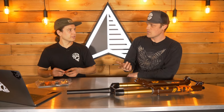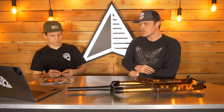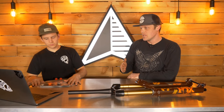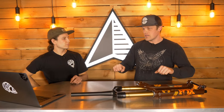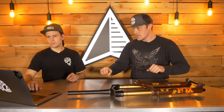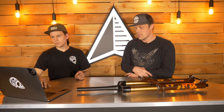Yeah. And a lot of people do call in and ask what's the difference. I guess if I had to put it in a way that's easy enough to understand without going into too many technical details, on the same bikes that I've ridden back to back, there's not one that's great and the other one's terrible. It's more that with the longer offset, the 51 mil on the 29er, I feel you have to put more steering input with your hands, and on the shorter offset you put a little bit more steering input with your body. So it just changes the way it handles, and one's not the end all be all, but I definitely prefer the shorter offset on most of the 29ers.